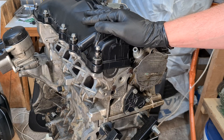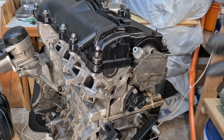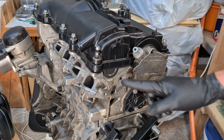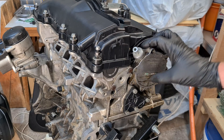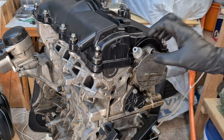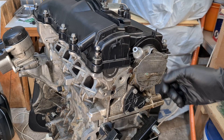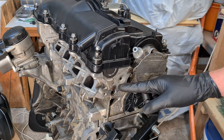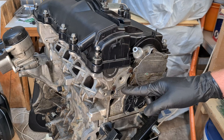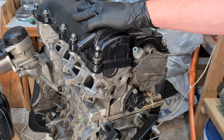This is an N42 engine that I have on my engine stand. Since these engines are quite old now, they get a lot of leaks, and one of the possible leaks at the back is this o-ring right here. It's not very common but it can happen. The most common oil leak is the vacuum pump — I have a video on how to solve that, link in the description and card. A subscriber wrote to me saying he identified an oil leak here at the back of the engine.